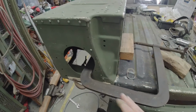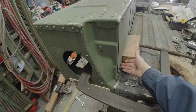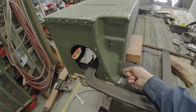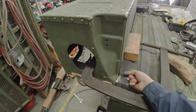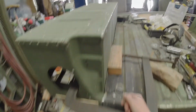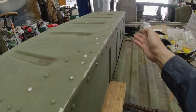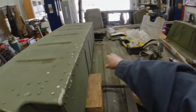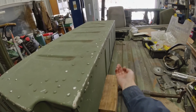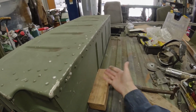Okay, when you test fit it, you drill a lot of your holes. This is why, because if you're drilling when you got glue in there, it fills up with the shavings, and then you'll never get that panel up against there. See how long the fender is? So I drilled all these holes. You could use a porta power and push that to that, but you have to secure this underneath first to the beams so it doesn't push the whole fender out.